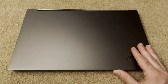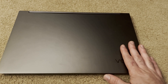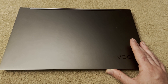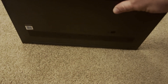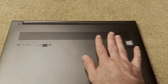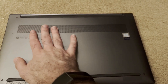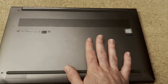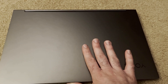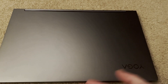The second laptop is my Lenovo Yoga C940, featuring Intel Iris G7 graphics — before the XE cores — and a 10th gen quad core, the i7-1065G7. It has a large vent, a metal bottom chassis with no mods, integrated graphics, maximum power draw around 65 watts, and steady state around 45 watts. This is representative of your average everyday laptop, with a dual heat pipe, dual fan setup.